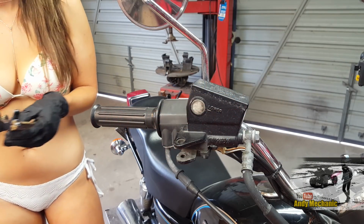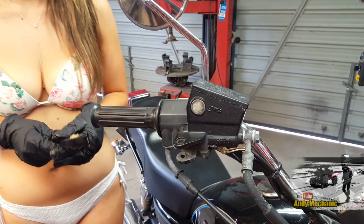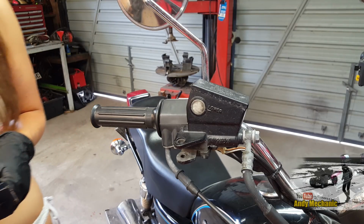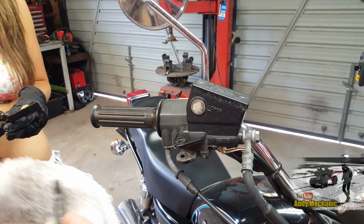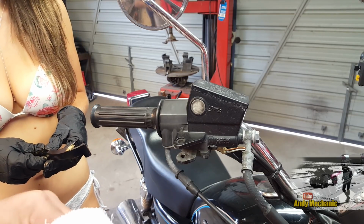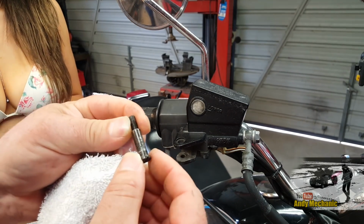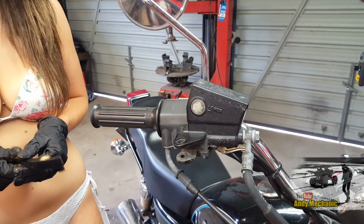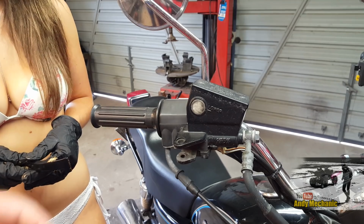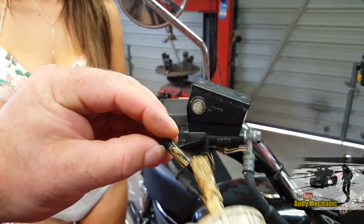Okay, so somewhere we had that little bolt, didn't we? So we need a rag to get that bit clean off. World's largest rag. Because usually the old grease dries up on there. There we go. Right. Cool, yeah. And we'll just stick a bit of copper paste on there as well, because that's really important. This pivot's nice and smooth acting on that lever.